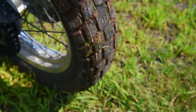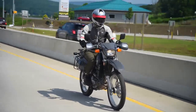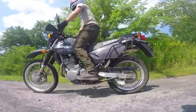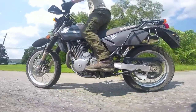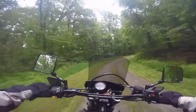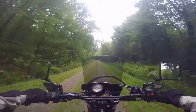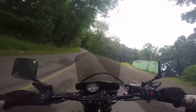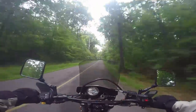I understand what Suzuki was doing here. What they wanted was to have customers buy this bike from the dealership and not immediately return it because it was too rough. They package this bike to be ridden away from the dealership and feel smooth. The only way you do that is to have tires that don't have much tread — not too deep and not too much space between the knobs. If they put DOT knobbies on here — tires with the minimum tread necessary to be road legal — they're the least capable of all dedicated off-road tires, and they're also terrible on the road. But they fill a gap for people who want an off-road bike that's legally street legal and able to handle realistic off-road conditions.